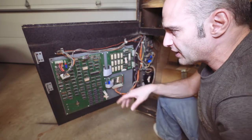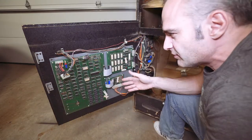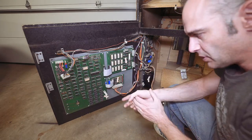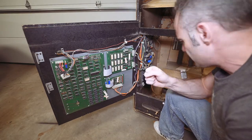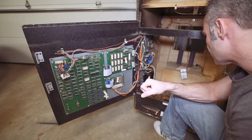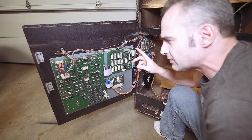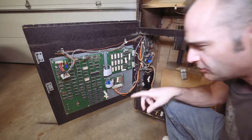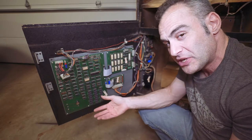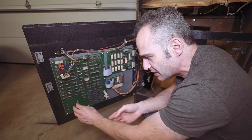With early boards, like my Robotron — I have a Rev A and maybe a Rev C or D — the Rev A or early board has all these little jumper fixes and the later board does not. And it says right on the board — this is a Rev B, relatively early. But you can substitute other boards; this generic board I believe is the same in Joust and Robotron. What's interesting here is it looks like there have been some mods done. Over here there's a power board and a sound board, and something that isn't standard — the battery compartment is gone.